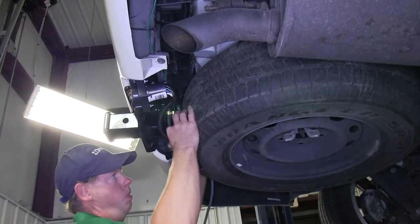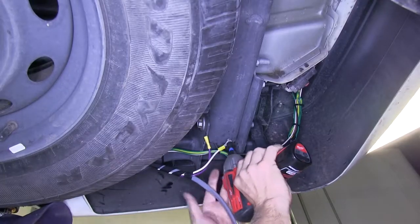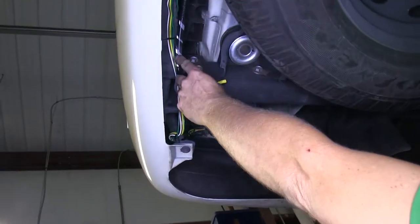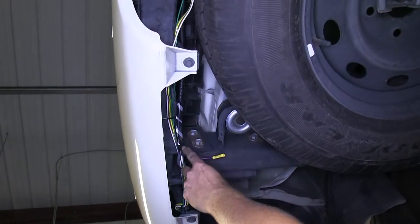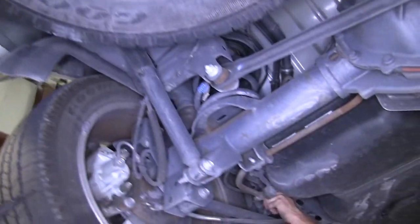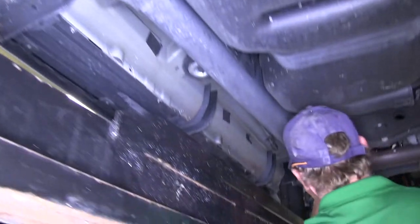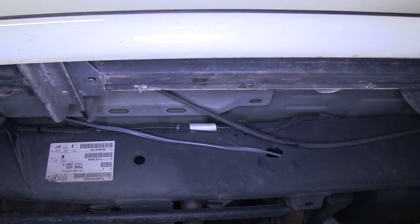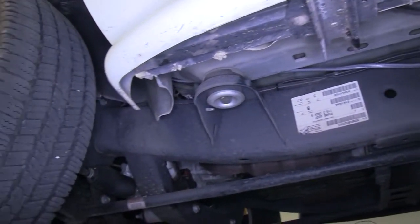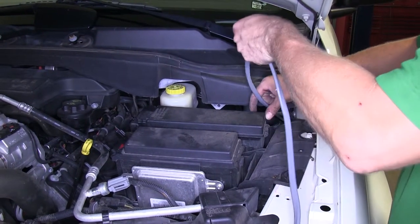At this point we can take our wires and tuck them up behind the spare tire. Then we'll take our white wire at the ring terminal and ground that to the back end of the frame of the vehicle. Now we'll go ahead and zip tie the wires safe and secure behind the bumper. We'll continue running our gray wire up to the front of the vehicle. We were able to run the cable from inside the frame to about three-quarters of the way up, using an old piece of airline tubing to help route it — a fish tape or stiff wire could also work. Then we'll continue running it up into the engine compartment and out by the power distribution box.